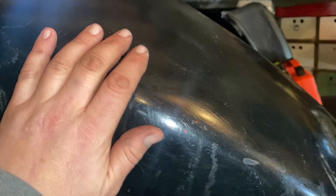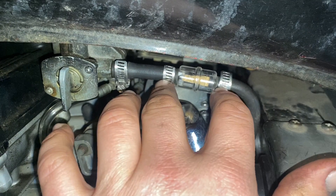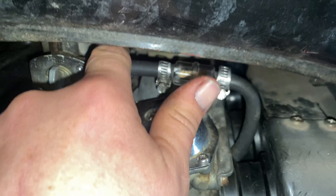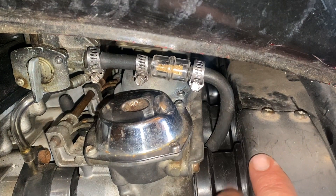The filter is good to have in here since this tank wasn't the cleanest when I was done with it, but we're gonna make this thing run. One note: that's a lot of metal in there. When you tighten these down, just tighten them snug and make sure it's not pulling apart. Make sure you don't crush the plastic in there — if you crank this down real bad it could crush this. This is metal so I'm not too worried about that, but just make it snug. You want to make sure these are not leaking. This is plastic housing so you could easily crack that inside and it will leak.